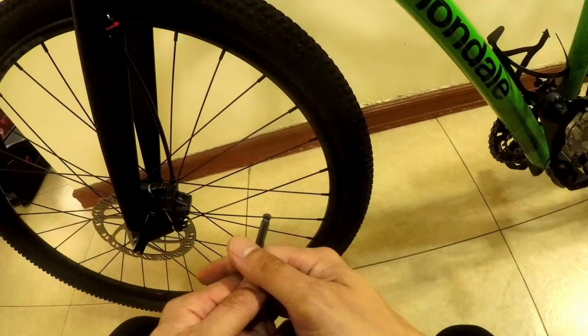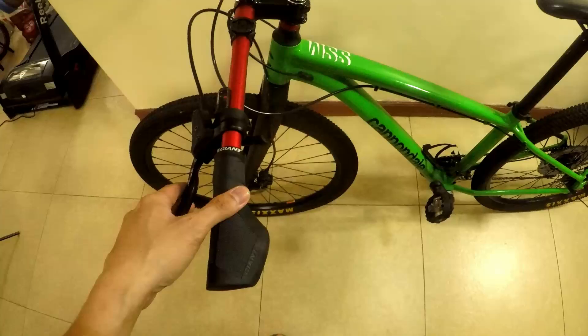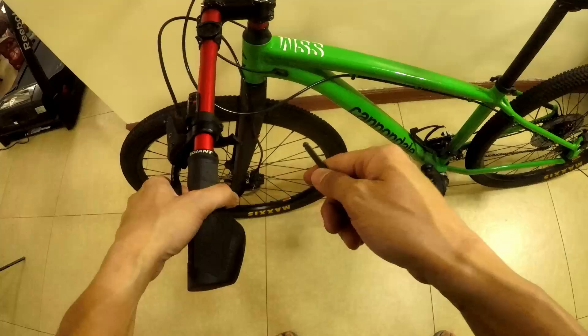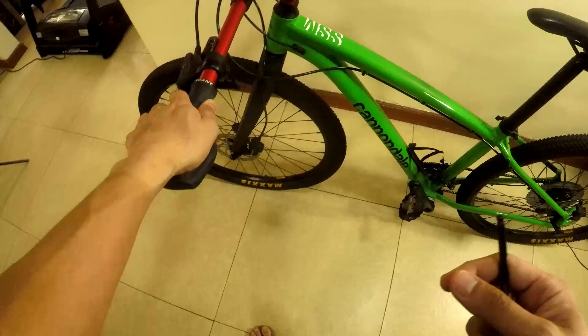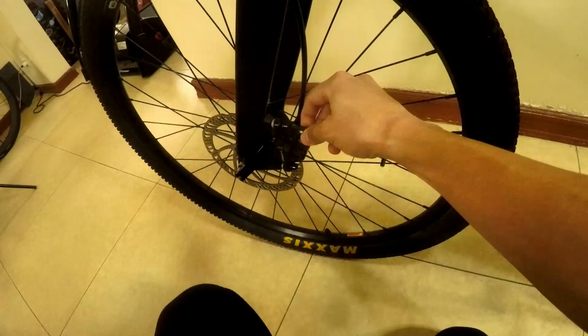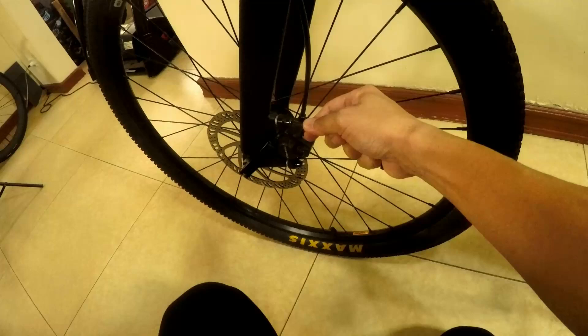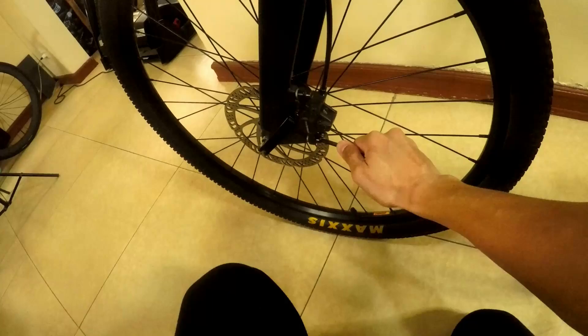This is the front brake. What we're going to do is hold down the front brake lever. The idea is to clamp the pads onto the rotor by pressing the brake lever — just enough for the pads to grip the rotor, not fully squeezed. You are centering the rotor within the disc pads by pressing the pads down onto it. That's the concept.